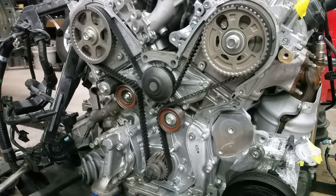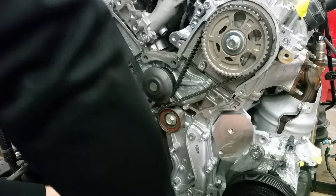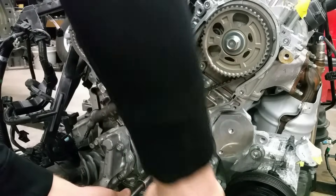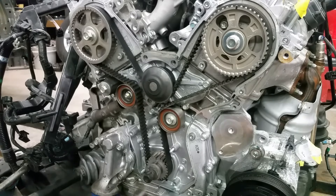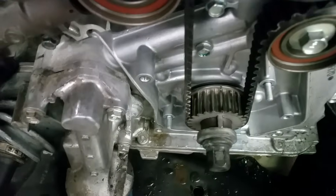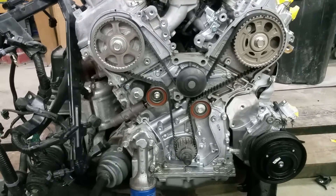It's coming right up — just about there. As you can see, I made two full turns on the bottom. If you pull the spark plugs out, it makes it a lot easier — but I made two full turns. Look at my sprockets: matches, matches, and my bottom also matches perfectly fine. That's how you set up a timing belt on any J-series engine.